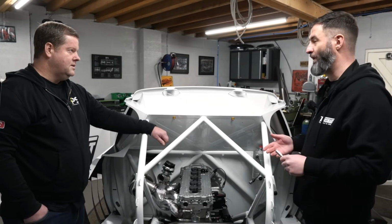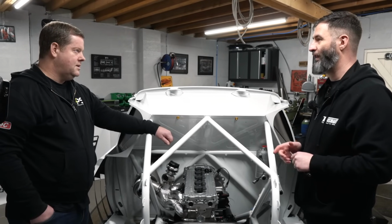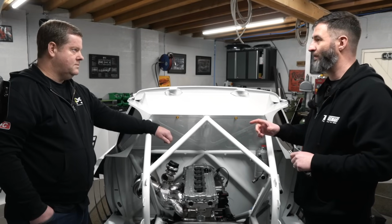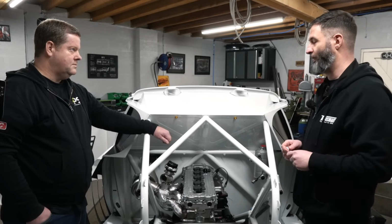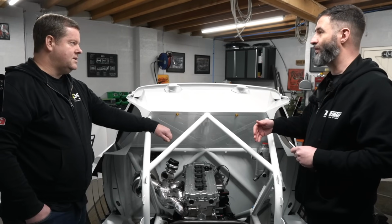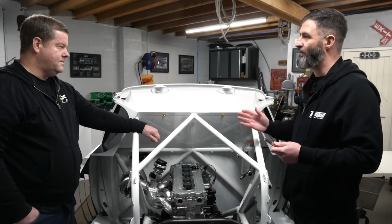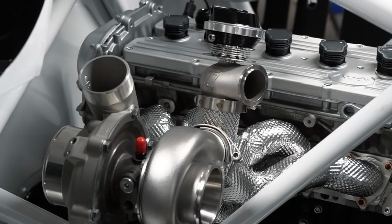That's fine. We can definitely help with that with an inline oil pressure regulator. Yeah, cool. That's simple, in and out, no need for a return. In theory, it's an inline filter with a pressure regulator built in. It does come with a filter as well, so it gets all the nasties out. If you have any swarf in the oil, et cetera, it'll prevent that turbo from being destroyed.